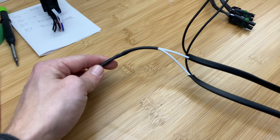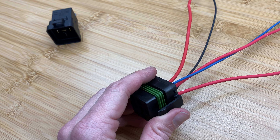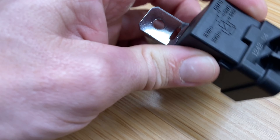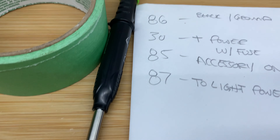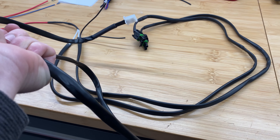These are the leads for the front lights — I've got them joined here. This goes to the relay at number 87. These numbers are on the bottom of the relay; you can see a diagram here. The power wire with the fuse is number 30. Next I'm going to do the switch wire — I don't have the switch yet, but this will go to the handlebars, about the same length, because I want all the plugs in the same spot. This one has a ground, so I'm going to join this ground with the two grounds from the lights and hook this ground up to the relay.